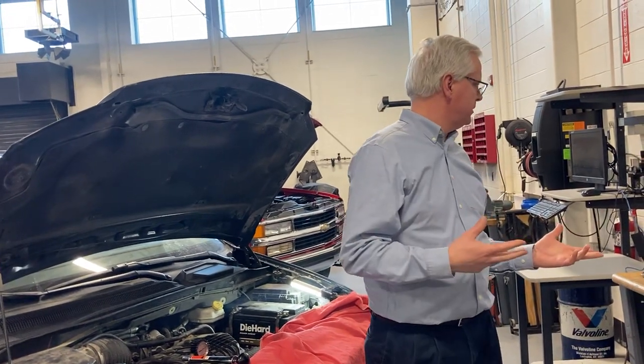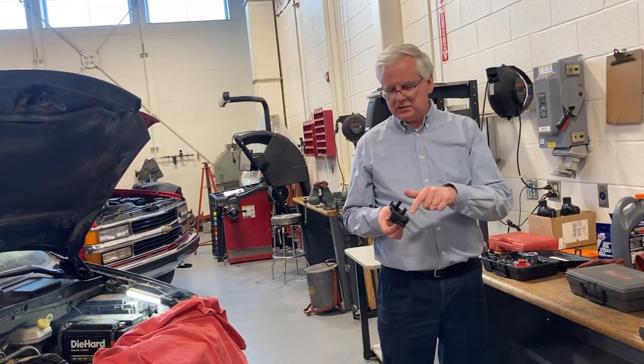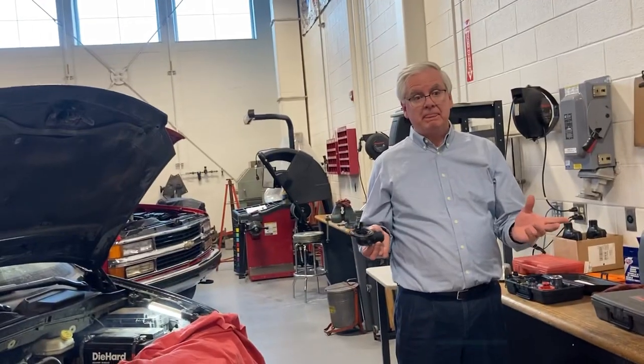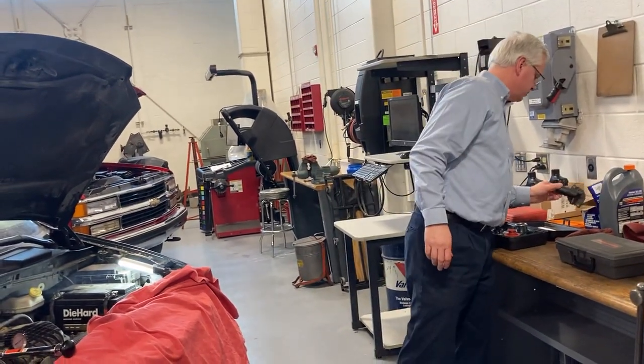This has a special thermostat in it. It's right there. It's all self-contained. It's got its own little housing and stuff. It's got a spring, and you can tell that this is broken off, so the thermostat probably just completely dislodged, so it's not going to operate correctly. So obviously, it gets no power, and it gets no heat. Mr. Austin was nice to put that in for us.